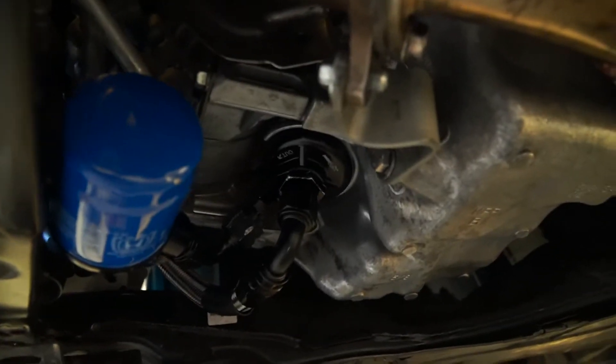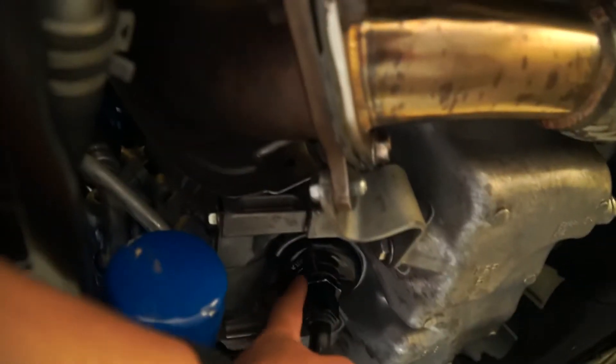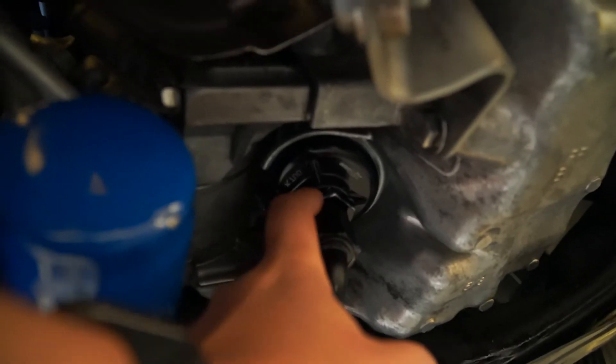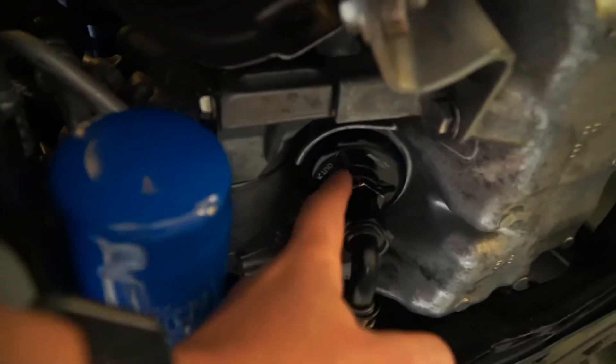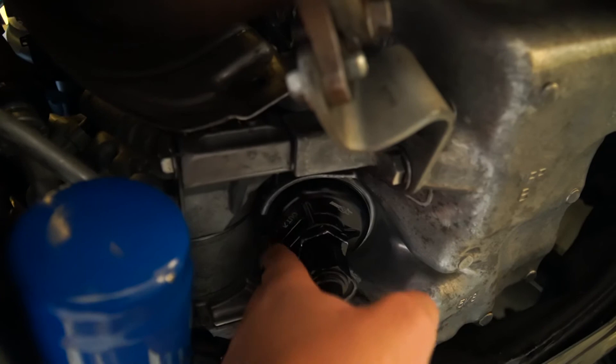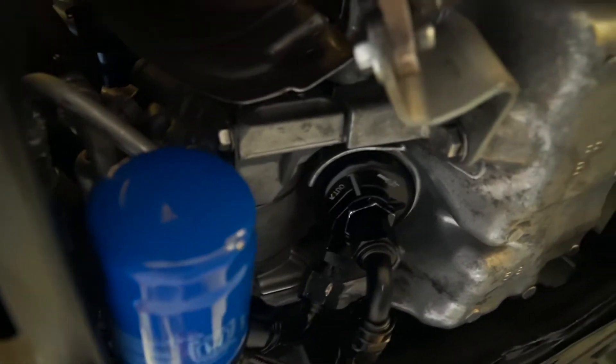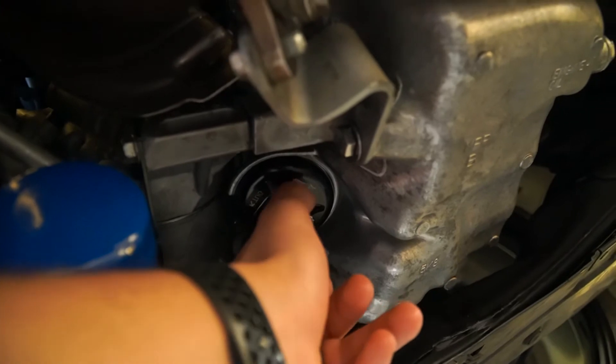I already found the problem where the leak was coming from. I lost a lot of oil. Basically what I did wrong - let me add some light for you guys - I put this aluminum washer in the wrong place. I don't know what I was thinking: I put the washer inside this thing instead of outside. That's why it wasn't catching anything - it was just pouring oil straight down. I was like 'what the heck did I do wrong?' Then I realized - oh, the washer. So I put the washer outside, which is how it's supposed to be done. I did damage the thread a little bit, but now there are no leaks.